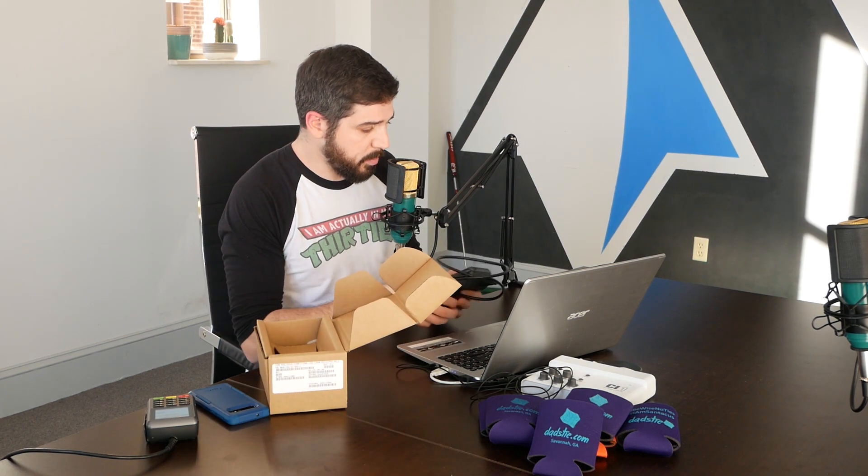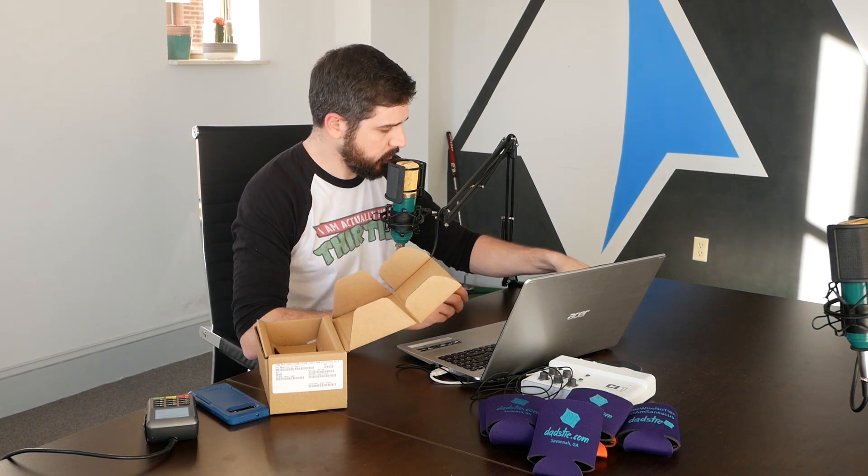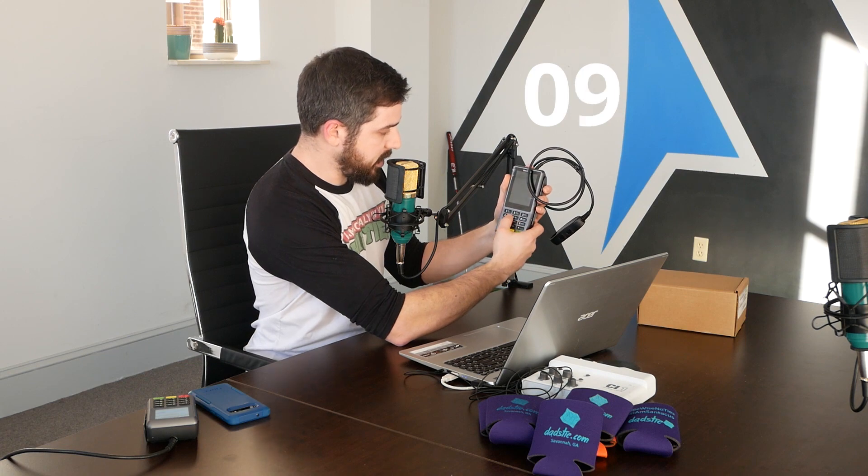Right out of the box, your device might not support Wi-Fi — you may be required to download some firmware. When you first connect it, just connect an Ethernet cable to the dongle, power it up, and it'll install the firmware for you. To connect to a Wi-Fi network, you can force the prompt by typing into the reader: 0-9-4-3-4. That'll give you a list of networks to connect to, just like you'll see on any other mobile device — pretty self-explanatory.